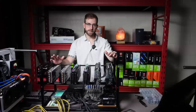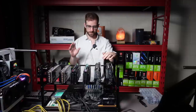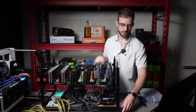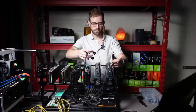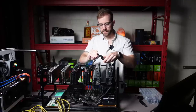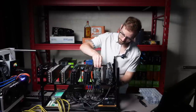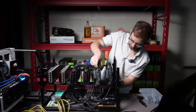I've got all the power roughed in here. I don't think I missed anything — we'll walk through it and I'll do the final connections as we go. On the 1000 watt EVGA power supply, I'm going to put two GPUs on there. Coming from there I have the GPU power, and what I'm going to do is put these two MSI cards on there. First I'm going to get the eight pin power going on top of the GPU.